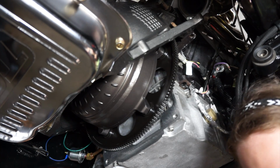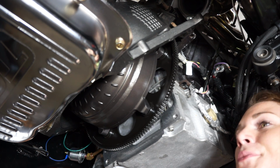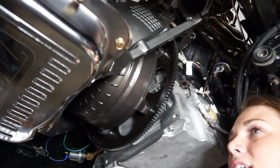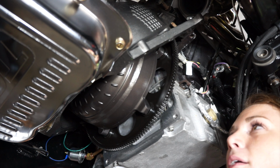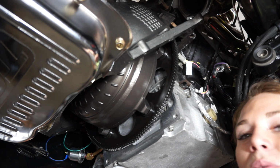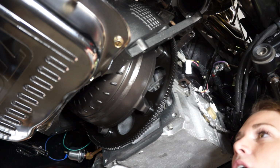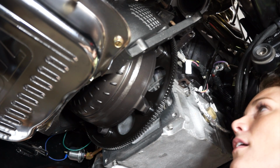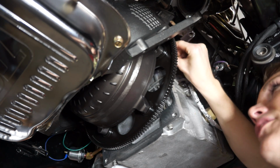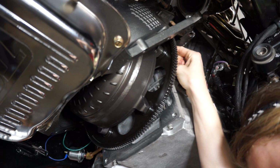Okay, so we just spent about 15 minutes scratching our heads over this silliness. We know in the past that torque converters have taken 3 bolts, even though we don't do that many automatic transmissions. We thought that was the case, but we have 6 bungs for bolts, and we were going, what the heck? Do we not have enough bolts? Do we have the wrong flex plate or the wrong torque converter? Because some of the bolts weren't lining up. But we called Will at TCI, and he said, no guys, it only takes 3 bolts. They made it a universal thing so that you can run the old school torque converters with our new flex plates. So if you're scratching your head too in wonderment of why your bolt holes aren't lining up, thinking you have the wrong parts like we were, don't worry. Just takes 3 bolts.